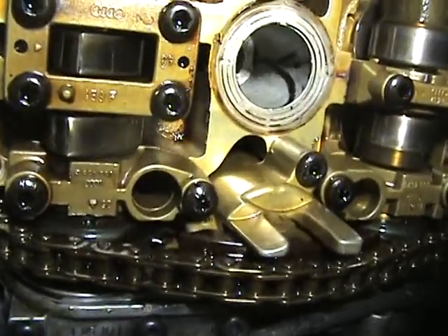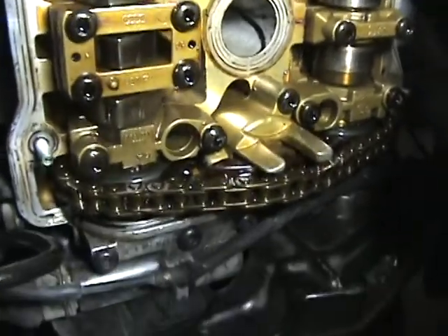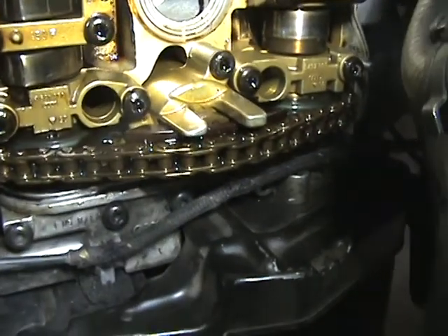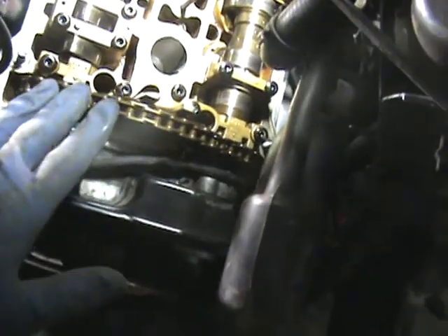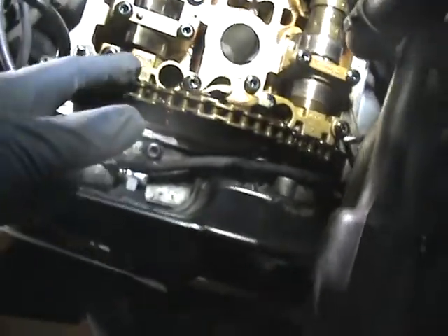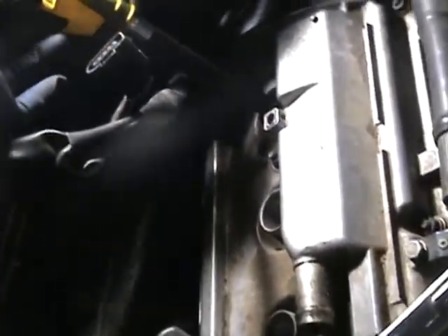I believe if you look in here, I don't see any markings on there — there's supposed to be some markings. And that's how you want this thing to be set up, because this chain is going to come off when I take the whole thing out, and I want to get it back on to match this, so that these things are all in that exact location. You can see that arrow right there — that arrow lines up with this little mark right there. And I have the balloon over here that tells me it's on top dead center when it's got air in it.